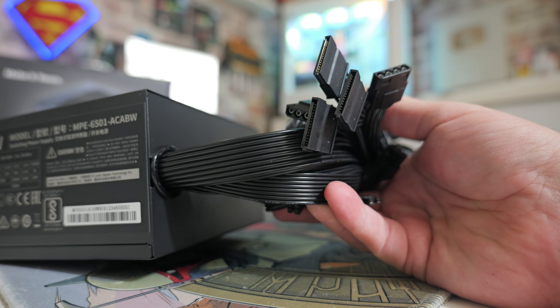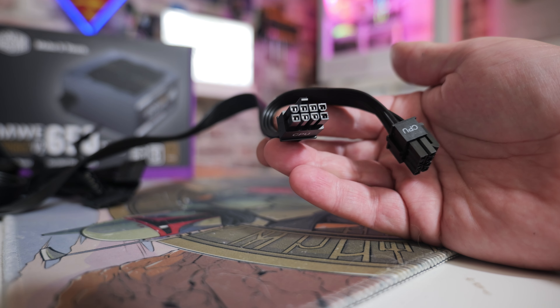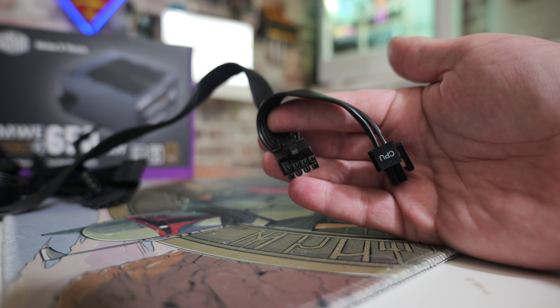Next, let's take a look at the actual cables — they've done the whole thing quite nicely with flat black cables of pretty decent quality. Starting with the main ATX power connector, this is a solid 24-pin, so you don't have that extra fiddly four-pin on the end which sometimes comes loose when building. This one comes in at 500 millimeters in length, which is about 20 inches.